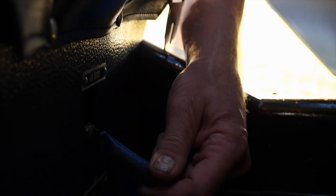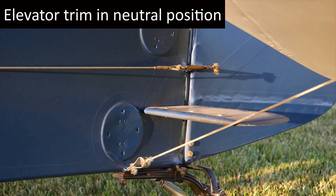So let's unpack that. Let's talk about the elevator trim first. In this particular model of Taylorcraft, the elevator trim is this simple lever underneath the pilot seat. The trim lever activates this little flipper, as Taylorcraft pilots call them, below the horizontal stabilizer.